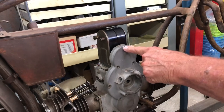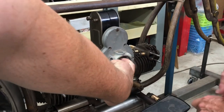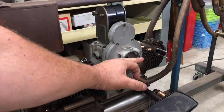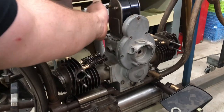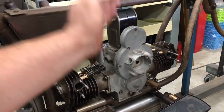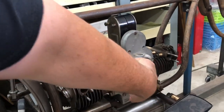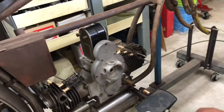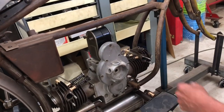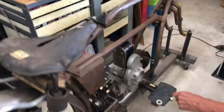So it's firing there — that'll fire the front cylinder. Yeah, fire that cylinder. But I'm wondering if the distributor actually needs to just be connected at the one point, or if it can actually have a wide angle of connection, and then the trigger is actually coming from points inside here. So that when that fires, wherever it is, it doesn't really matter — a little bit of... yeah, that's right. So it could be a nice long lead, brass strip or whatever it is that it rubs against. Because usually you have a carbon brush running on a brass strip. So you're right — that would then take away the need for it to be precise.